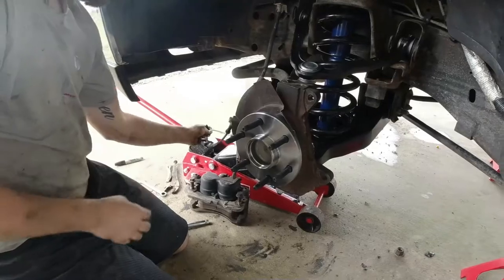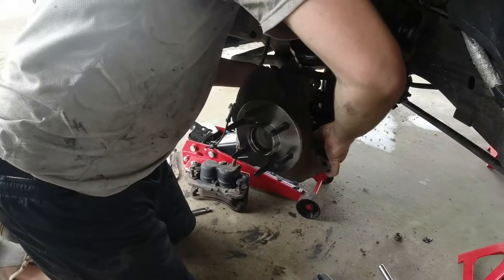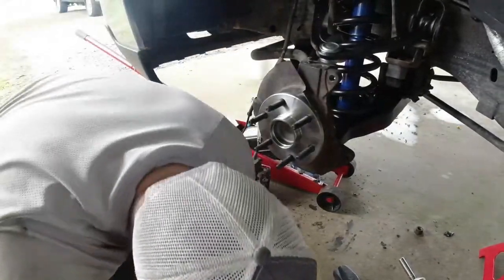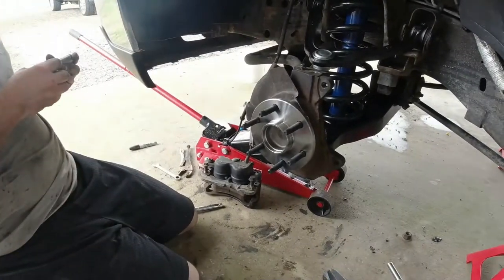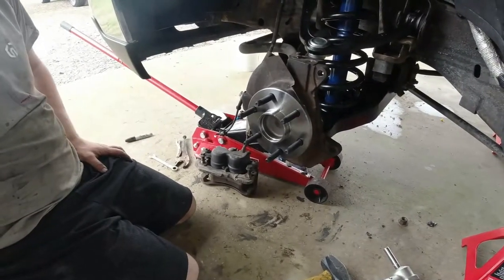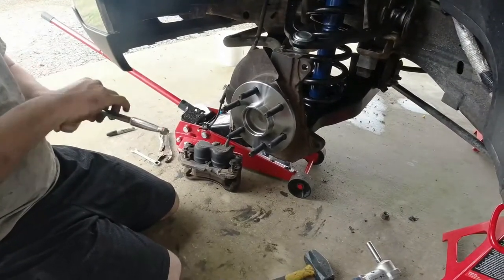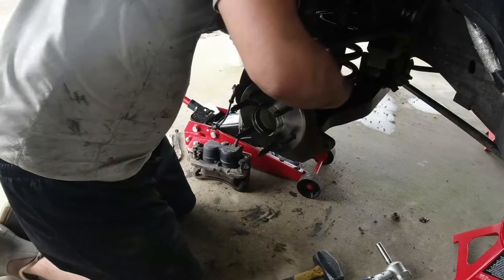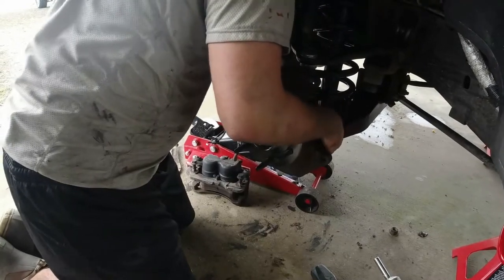And so, again, y'all, it's so much easier just to buy a new hub than to change that wheel bearing. And the whole premise of this build is everything has 200,000 miles. The suspension, the engine, the transmission, everything on this truck has 200,000 miles. Those ball joints, those tie rods, those bushings, and that wheel bearing. The last thing we want to do is put a nice motor that makes some nice power and goes good, and we got an old shit wheel bearing on there. So instead of fighting and beating out old wheel bearings on old hubs, I just change them all. That's what I do. And you come brand new studs, so much easier, so much nicer to work on.